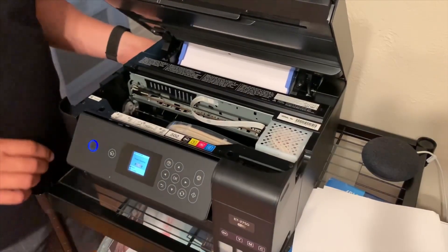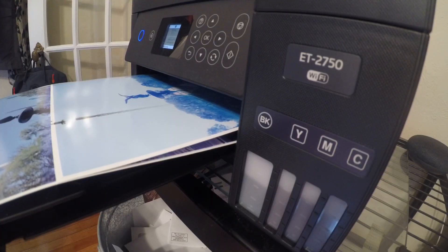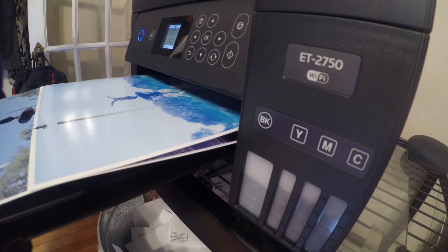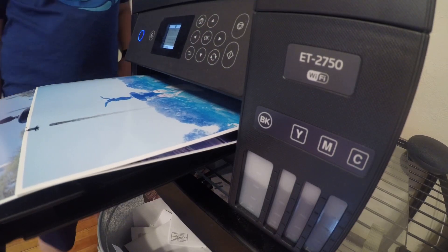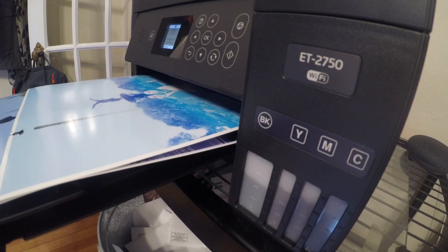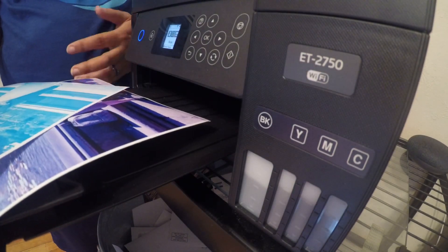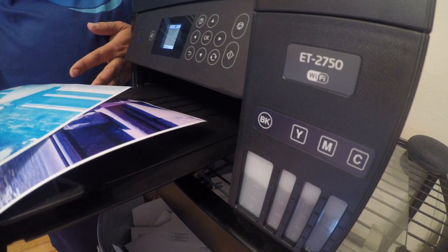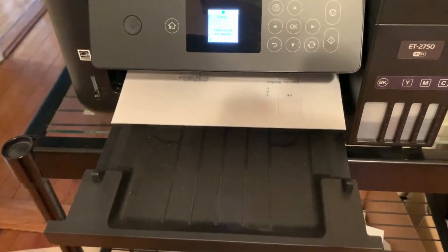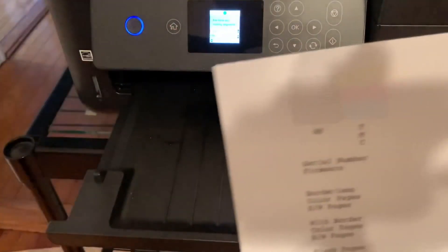So this time I performed the power cleaning and it really did make a difference — it fixed everything. What caused that smear was that I switched paper types: I was printing on matte and then switched to glossy, and the paper I had might have been old. I've heard others complain that some glossy paper — even Epson gloss — might cause a smearing problem that clogs the print heads. The only fix was a power cleaning, which uses a lot of ink. I want to give a warning: make sure the paper you're pushing through this printer is compatible, because it can cause this issue. It looks fixable, but it'll cost you ink.